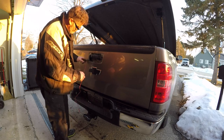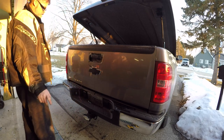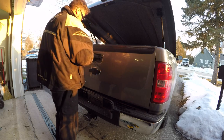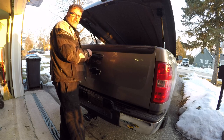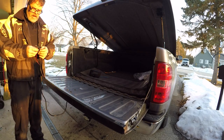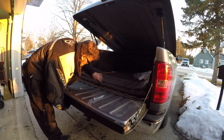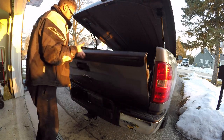Freaking right. So what I'm going to do is ground this back here somewhere. But will that be a good ground? Probably not. I probably should have left it outside and grounded it on the back side of the box. The tailgate's always moving so there's not much of a ground. I'll pull it through this way, feed her back in the loom and pull her back through, and we'll ground it on the back side of the box. Stop right there until I get the camera hooked up.